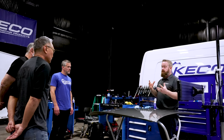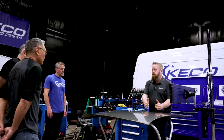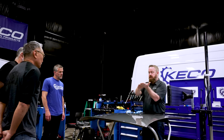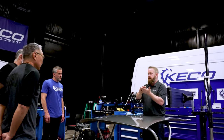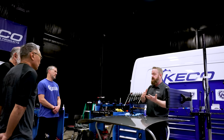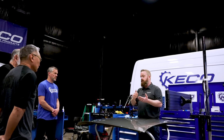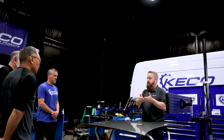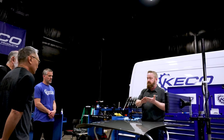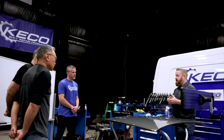The evolution of learning is you will go from a fillerless repair to being able to get it close enough that wet sanding, taking thickness out of the clear coat and polishing it back up, will make your dent invisible. Technically, a paintless repair, because you've not added paint. And then the ultimate will be when, and if you choose to chase it that far, you can take that same dent to a level where it's not noticeable without having to remove any paint with paper. It all comes down to being able to read the light and be accurate.